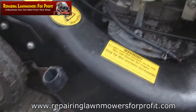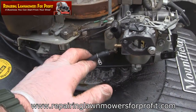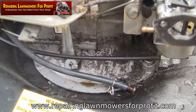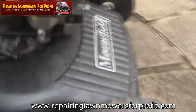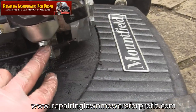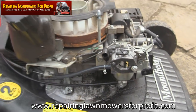I'm going to put this air filter box back on — hold it up from underneath, push it on and shove it all back together. But before you do that, always connect the fuel line first. Otherwise you get it all back together and you'll wish you'd checked — once you've got this box back on, you can't get behind it to reach the fuel line either. Make sure you've got no leaks from the bottom of the carburettor. As soon as you connect the fuel line, fuel flows through, and if you see even one drip, you know the washer isn't seated right or the needle's stuck and overflowing.